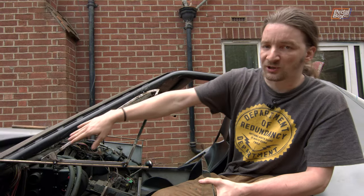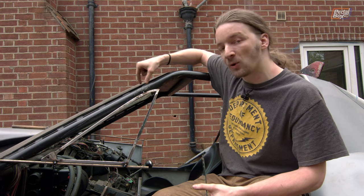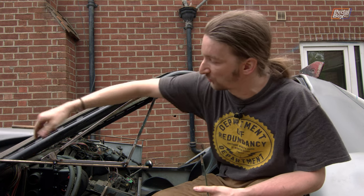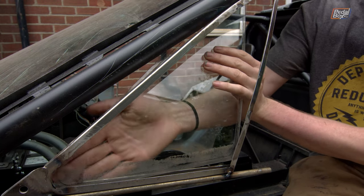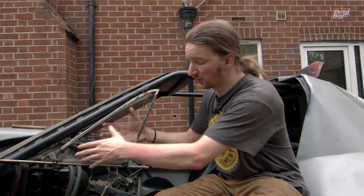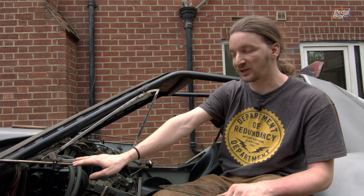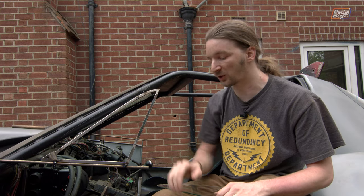The angle doesn't perfectly match down the front here, but in terms of the total pillar size it actually works out a lot more consistent than it looks, because at the top we've got quite a wide amount of pillar taking up the gap between our upright and the windscreen, and that just rotates around as it gets narrower at the bottom. I've got to be quite careful — I don't want to break the glass, but it does just fit in. This is going to be held in by mastic-y window sealant, the same kind of thing used to bond a windscreen, podged in from the inside. This defines another chunk of bodywork and finally gives us the shoulder line to finish off the top of the wing going back to the side mirrors.